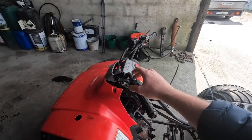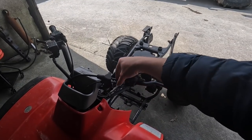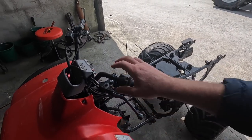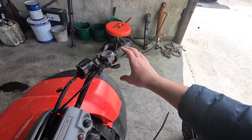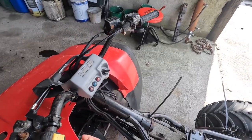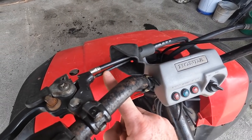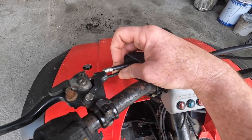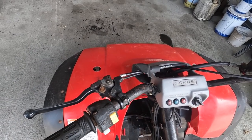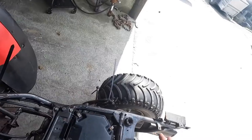Another couple of things we need to get is a new latch over here. We'll probably end up buying a new latch. I just priced one online last night, and they're not hugely expensive. So we'll get a brand new full mechanism for there. Everything over here is okay. Nothing wrong there. Nothing needs to be touched. Cable going to the reverse. You can see here it's all opened up. It's all bubbled. There's obviously rust coming underneath the cover. So we're going to replace that reverse cable. We have our new brake cable already run. We just have to hook that up on the back.